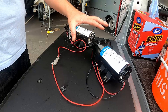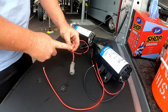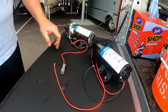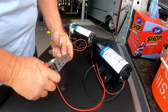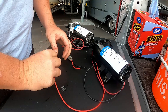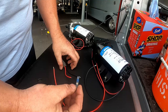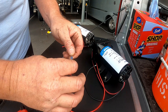We have the old pump and the new one. The old one has a nice connector on it and the new one comes with bare wires, so what I'm going to do is marry this connector over to the new wires so I can just plug it directly back in. I'll use a little bit of wire to give me more room to work with when I'm down there. Cut these off and strip a little bit. Then we'll connect them with these wire connectors — I like to use the solder-seal type. You stick them in, there's a little solder in there, and when you heat it up it shrinks and makes a really good, tight connection.